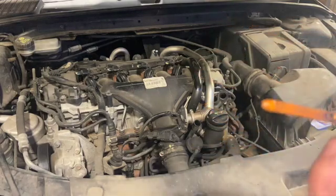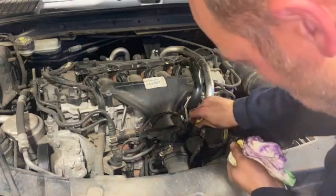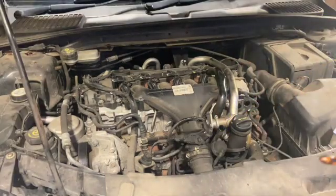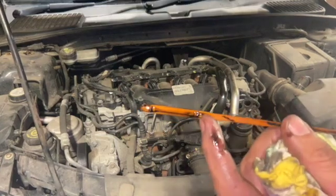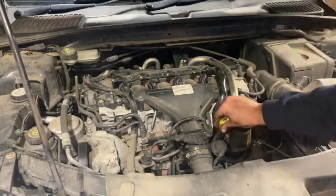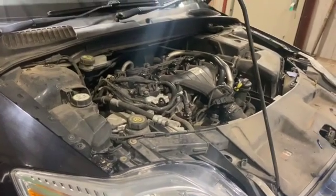Pull the dipstick out — you can see the little gauge on there showing minimum and maximum. Pulled it out and it's absolutely bang on the max — spot on. What we're going to do now is start it up and leave it on the ramp running for about five to ten minutes, have a good look underneath to make sure everything's sealed up, the fuel filter's not leaking, and there are no signs of leaking from around the bottom of the oil filter cap. I'm going to do the cam belt tonight as well, so there'll be another video for that. And I'm going to go inside to reset the service light.